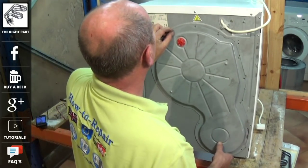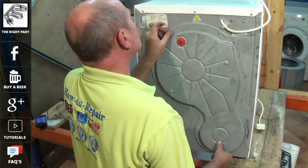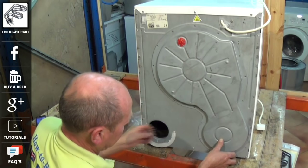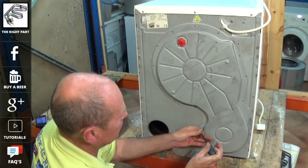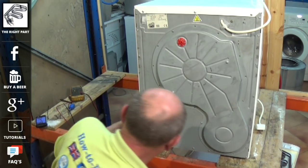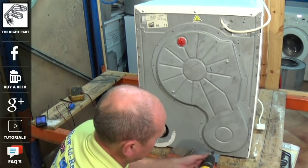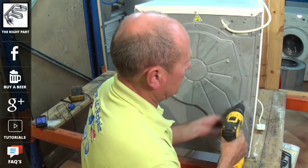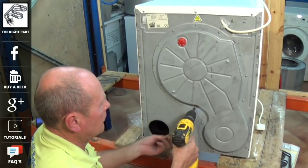Replace the back cover and now we'll do a test on the machine. I'll show you the heater working on both sides using my test meter. When we plugged it in before it was tripping the electricity immediately, but with the new element the tumble dryer runs and you will have a high and low reading on the element.